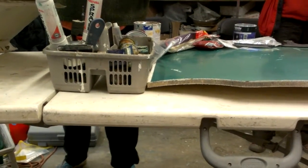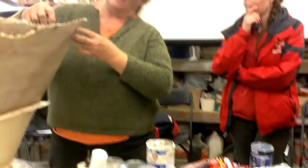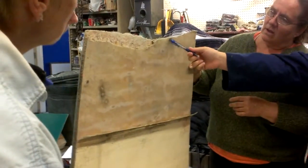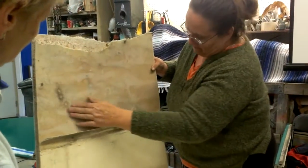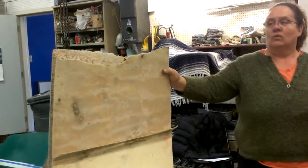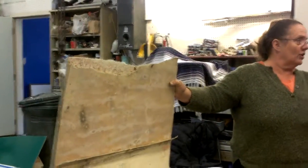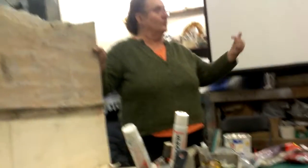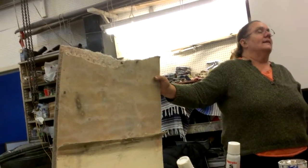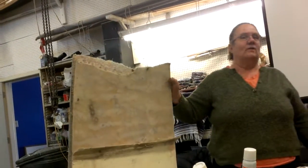Because you see how this stuff, that's all like mold that was on the inside of it, where water came in. You can see that that's delaminated. On the inside, if you're seeing this, it's probably just stuff from the inside. What I would look for is in the area where your fasteners come through the deck. If you start seeing little rust there or you see drips there, that would tell you that you might have something going sideways. Then you're going to pull it anyway, to clean up the caulking around it. So, rebedding.